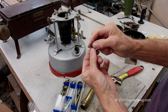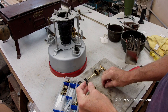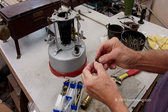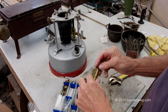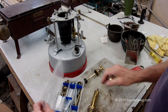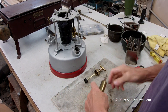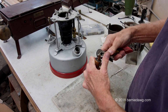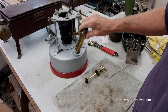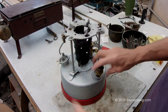I've replaced the pip with a blue Viton pip. Viton is great for this — if you can get it, get some Viton, it's very fuel resistant. We can put that back together and now we'll be sure we don't have any fuel accidents. You can cut the pips yourself — just get yourself a punch set off eBay or wherever.